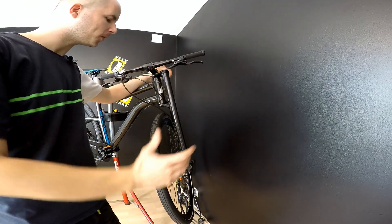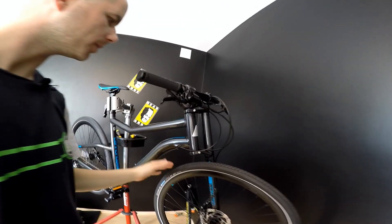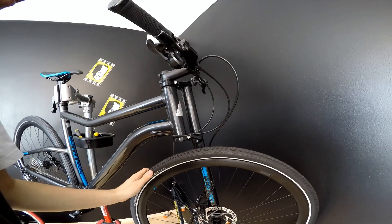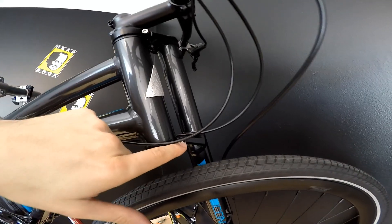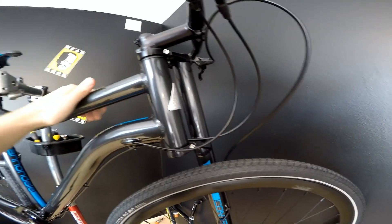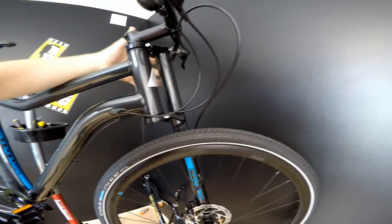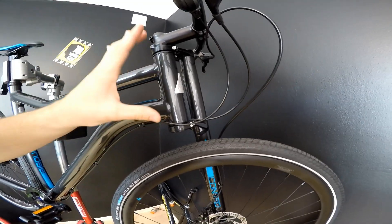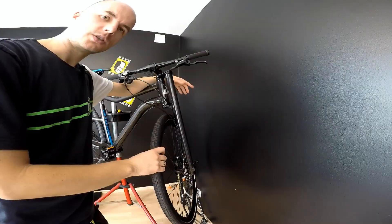Overall, these forks have many more advantages than disadvantages, that is for sure. The last thing to mention is that you can mount this on any bike, because the steering tube for Lefty forks is exchangeable — that's why you can see those bolts here. This is a double-crowned fork with an exchangeable steering tube, which means you can fit it into a 1.5 inch head tube or into smaller bearings just by replacing the steering tube.